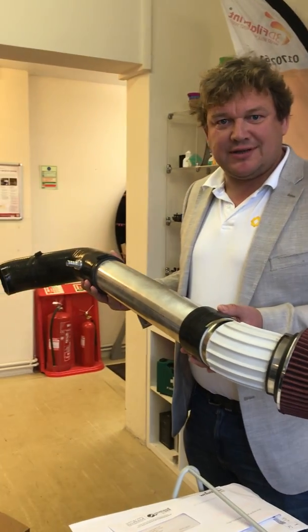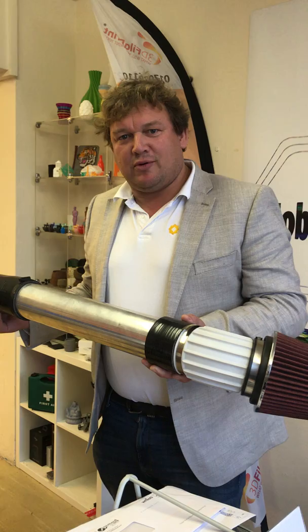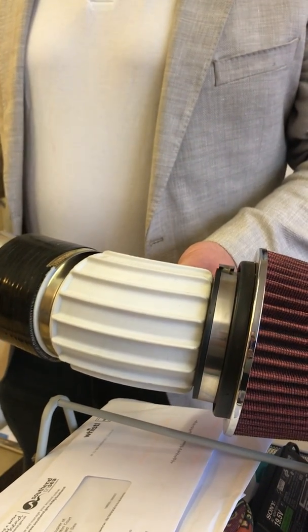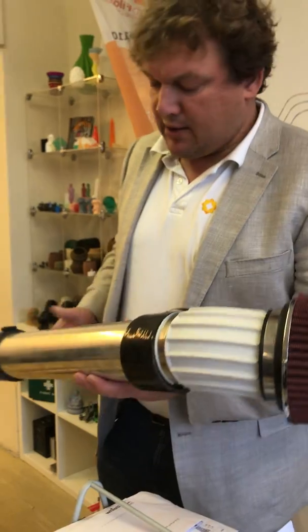For the motor car enthusiasts out there, check this out. This is part of — most of — the intake section from my car, which is a 1969 Reliant Scimitar GTE SE5 Resto Mod. It has a 24-valve Alfa Romeo engine with just over 200 horsepower — about 50% more than the original. I originally built it as a road car but I'm gradually going more towards a track focus. This part here is 3D printed with the Nano Diamond material. It's a first attempt — it has been on the car and has been running. I've measured it up to about 70 degrees centigrade and it still holds up well. I'm going to do another one with a slightly different angle and then enclose it as a complete cold air intake.